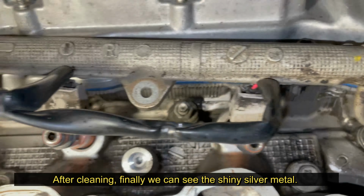So if you completely pop out all the fuel injectors, you can pull this back. And of course, you can haul this away this way. That's fresh motor oil. I'm just gonna dab some around the end of the new O-rings that I put on before I snap it back into the fuel rail.